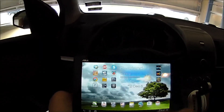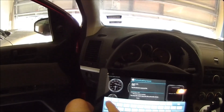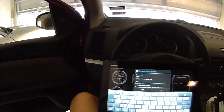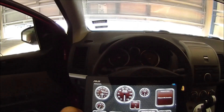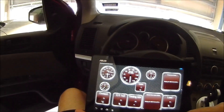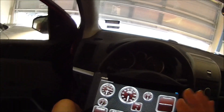What I found is if you pair it now and then open up Torque, it doesn't work. So go back and open up Torque instead. As soon as Torque opens, there's a Bluetooth pairing request. The code is typically 1-2-3-4, or I've seen reports that 6-7-8-9 might work as well, depending on who made your device. You'll notice that Torque immediately says it is connected to an OBD interface.